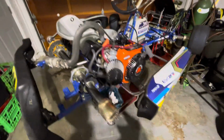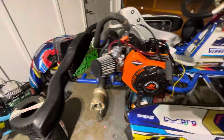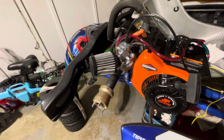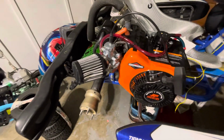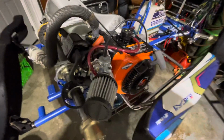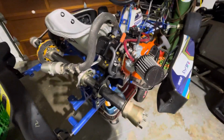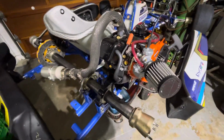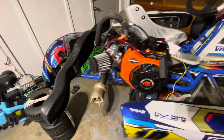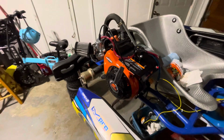And there's a rule on the spark plug. You can either run the Briggs and Stratton one or an Autolite. The carburetor, your jet sizes are limited, so you're not allowed to be changing them. And I have tools to be checking that stuff. That's what I do at the track at the end of the races with the top 3 carts. So this engine puts out 9 horsepower. I have a dyno sheet on this motor. And most of them are very consistent, okay?